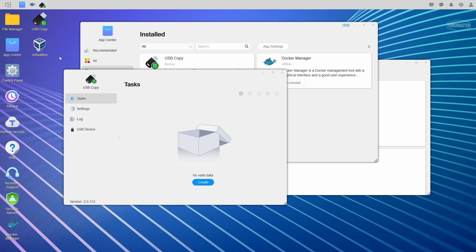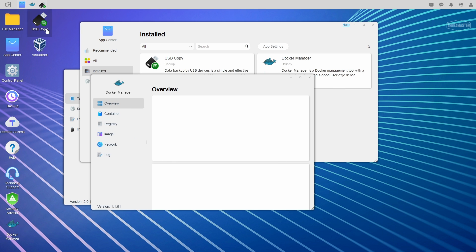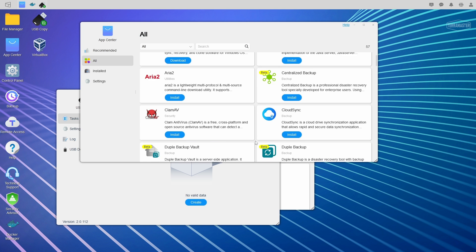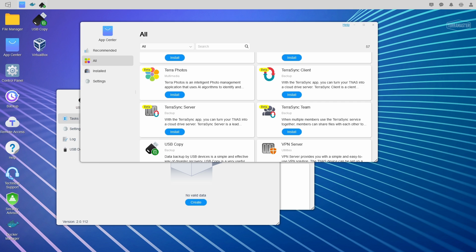Like I said earlier, this does run Docker and it runs virtualization — those are my two main things when running a NAS. Back then you wouldn't even think about doing this, but it's gotten to a point where this could run as your little home server. Virtualization and Docker work. They have their own USB utility where you can plug something into the USB port and automatically transfer data into your NAS. They also have backup utilities and antiviruses — their own bunch of utilities. I'll leave a link in the description below for third-party applications such as Jellyfin or Deluge and other programs you can install. So not only do you get their official packages, you can also install third-party packages. I'm mainly happy that you can install Docker and also Portainer, which allows you to use my Pi-Hosted template for x86, and you can get even more involved in running a NAS.